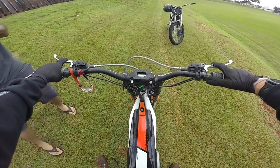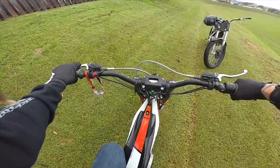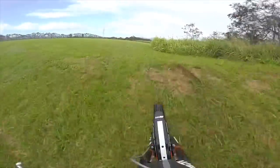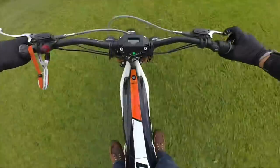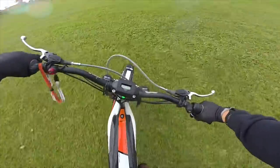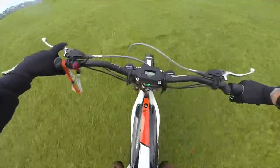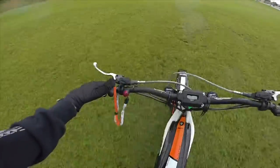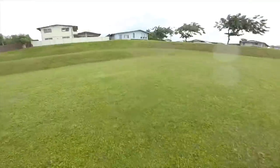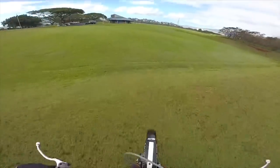Okay so we're in green map. Hold the clutch in — there you go. Your angles are a little different than mine. We're in map one and it'll pull the front wheel pretty easily even in map 1 on this bike with the gearing change. I'm pretty much leaning over the front and it still pulls it. This button on the side by my thumb is the regenerative braking button — that charges the battery up under braking. On the other bike the clutch does the same thing. This one has a lot more torque because of the gearing.